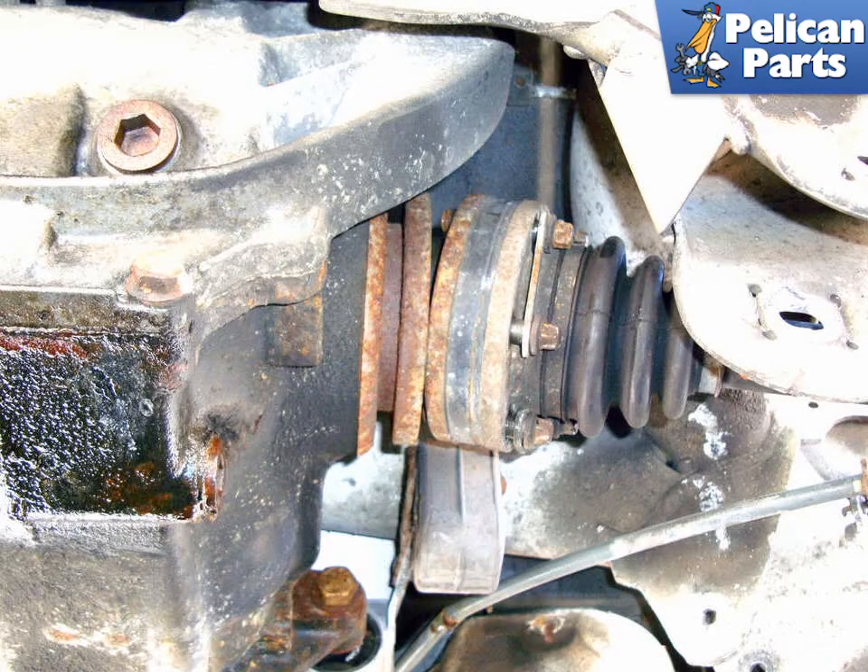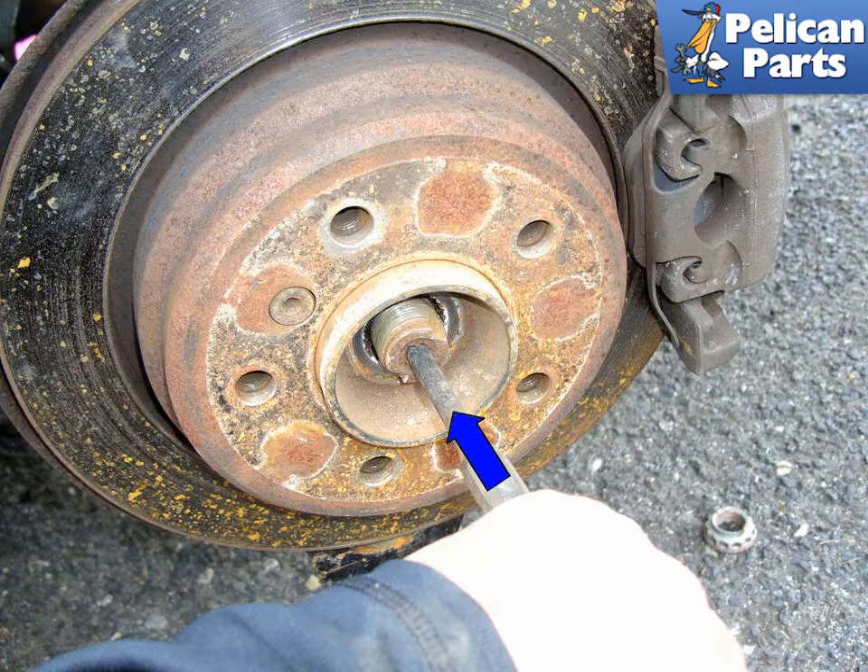There is more than one way to make some room to get the axle shaft out. You can remove the lower control arm to spindle mounting bolt, or you can do what we did here — we removed the lower control arm mounting bolt on the subframe side. For additional assistance with that, please follow the link provided at the end of this video. With all the fasteners removed, move the inner CV joint away from the flange and let it rest on the rear suspension. Use a drift punch to tap out the axle shaft from the hub and the spindle it sits in.